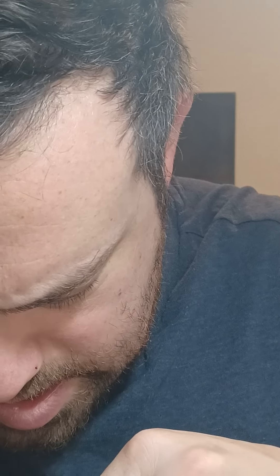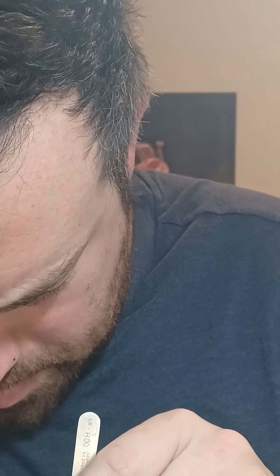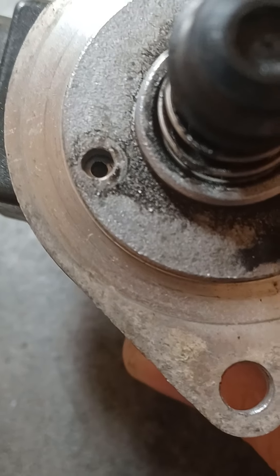The magnet rotates in here — that's why I recommend putting some dielectric grease in there as a lubricant. Wave washer goes under the bearing, bearing goes in, then the magnet goes down on top. Now take the plastic cog piece and find the happy spot where it slides in flush. Once it's slid in, make sure all your screw bosses line up. You can use a small dab of blue Loctite on the screws.